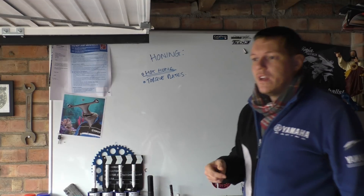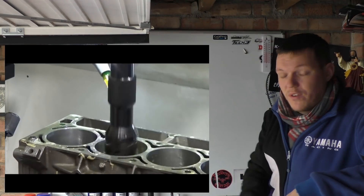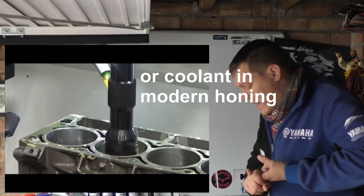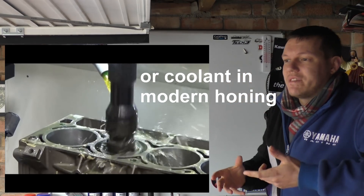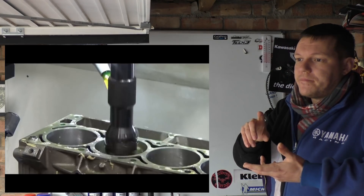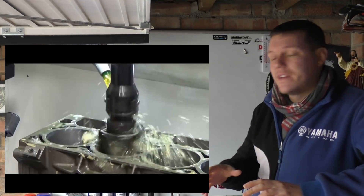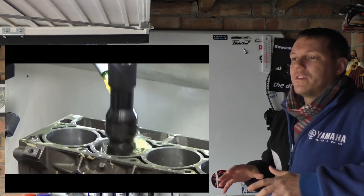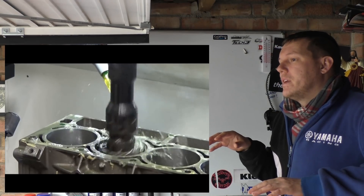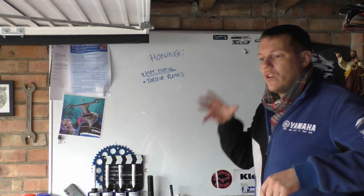What is hot honing? Well, you'll see when they do honing — I'll show you a clip — but there's all this oil being squirted at it. That is for two reasons. One, that's to keep the block nice and cool, because obviously any kind of grinding process, which honing is, is an abrasive process. The block is going to get hot, which means it's going to expand in weird ways. When you are trying to abrade with grinding, keeping things cool is of big importance because it's going to change the dimensions as you're honing.